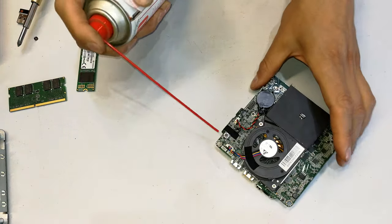So that was the problem — the button had some dirt and liquid in it, and just using some contact cleaner solved the problem. Thanks for watching, cheers.